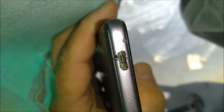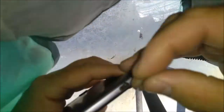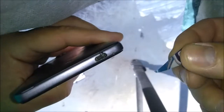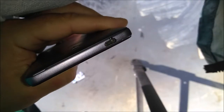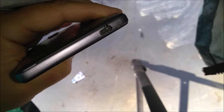I've got a rain jacket over my head so the lighting is better. You can see the inner part you need to clean around, and the hard part is that part behind — I don't know if I'll be able to catch it on camera, but I'll try. After a while your tip gets dinged up; maybe you've got to straighten it or do another one, but that's the idea. It looks like this one wasn't that dirty, but sometimes you get a ton of lint out of there, and it just makes it hard to push the USB cord in.